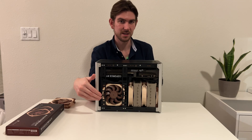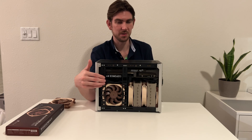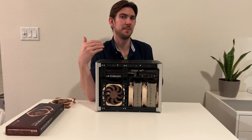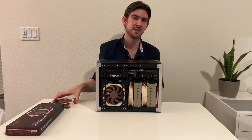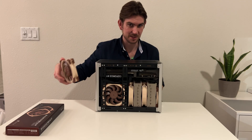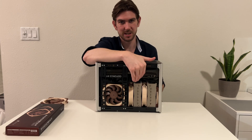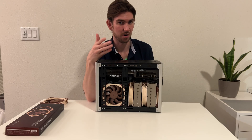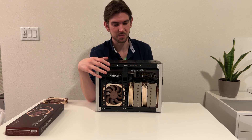With the new fans, they're noticeably quieter — I can't even hear them because they're spinning at a lower RPM — and it was only one Celsius higher. They are much quieter and Noctua talks a lot about efficiency in their video. They also have higher static pressure since these fans are more suited for a fin stack or radiator. This one is pressed against a fin stack, so it did create a bit more efficiency at a lower RPM, which is really incredible. I didn't think they could make a quieter fan, but they did.